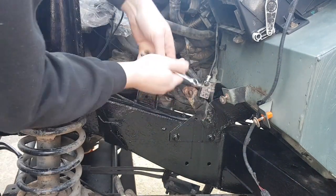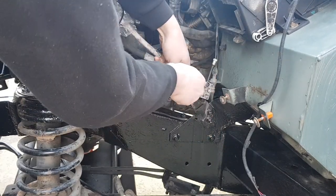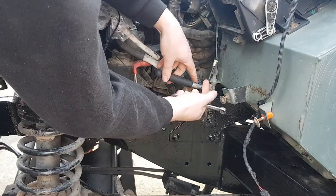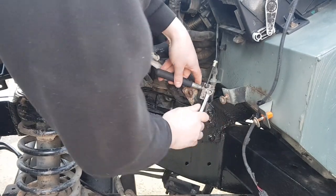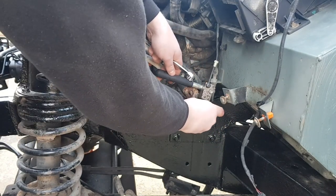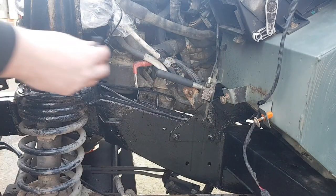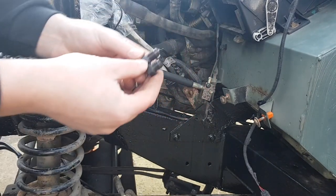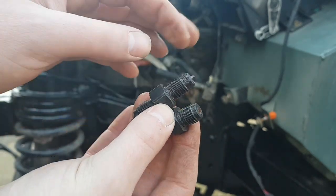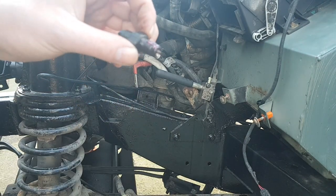10mm. That then clamps onto the pipe so it doesn't slide back when you put the flaring tool in. And now work that, take that out. I'll show you why that's needed now. So see on the camera. The little point here goes into the pipe, crushes it back and it makes a flared end.